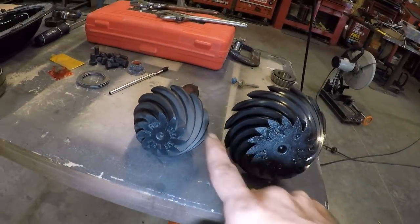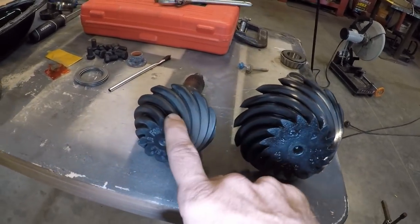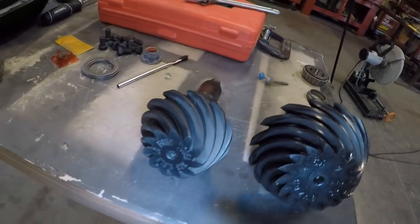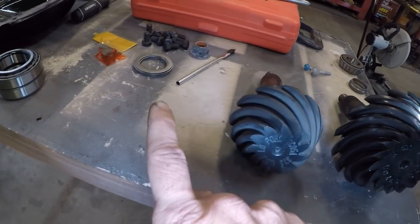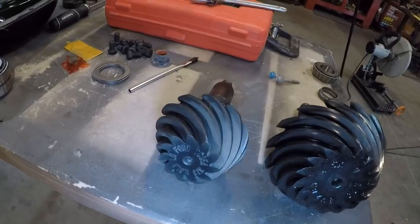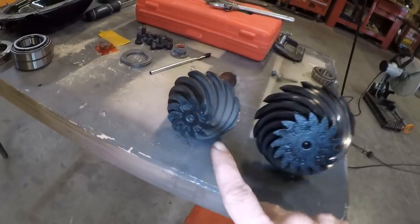Now, when they get numerically higher, the pinions get smaller and smaller. So this is 273, this is 373. One more rotation, pretty cool. When you go from a 273 to a 373, imagine like a 529 or something crazy down there. You get to the point where these pinions are just so tiny, and that's where the gears actually start to get weaker.